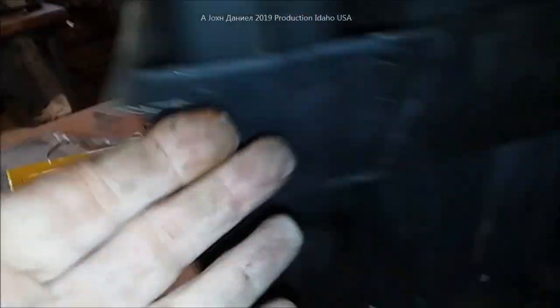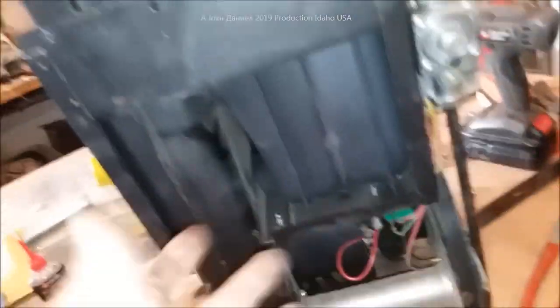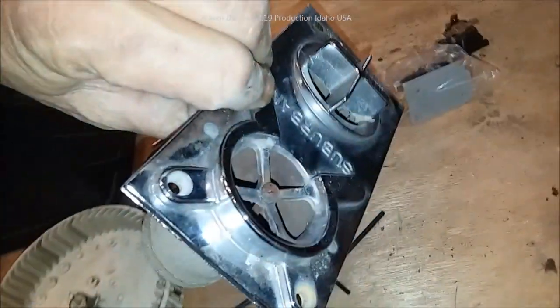These are real simple to remove. You do have to pull the unit from the container — the furnace housing — and typically you've got just a screw or two up here in the front that goes into the casing. You'll be able to physically slide this right out the front. You don't actually have to remove it from the RV, but it's a lot easier. The exhaust and everything will just slip off — it's a slip fit.